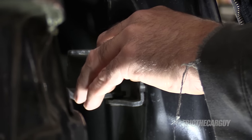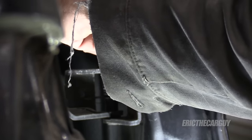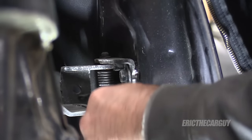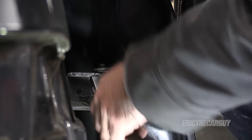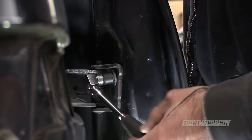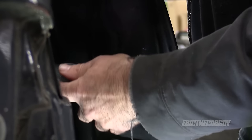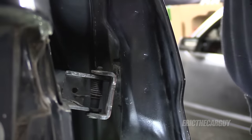I've grown to using markers rather than scoring the paint. I used to score the paint with my pocket screwdriver, but that can eventually invite rust — no one's really going to see these marker marks. If it's sort of binding on the last fastener, just adjust your floor jack a little and you may be able to find that sweet spot. Be careful when this comes down that it doesn't damage the paint.